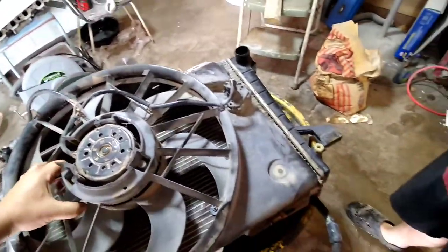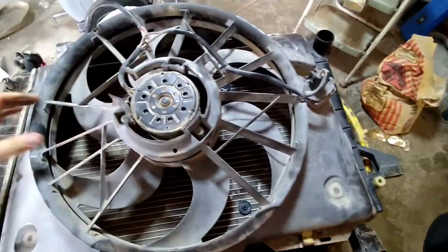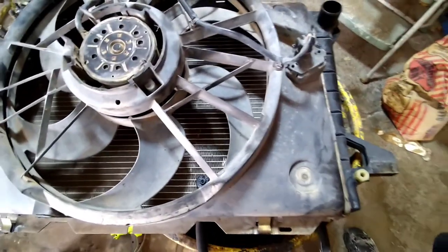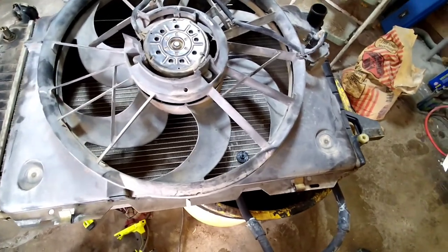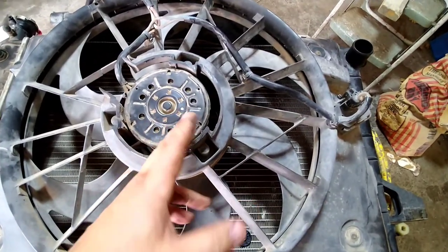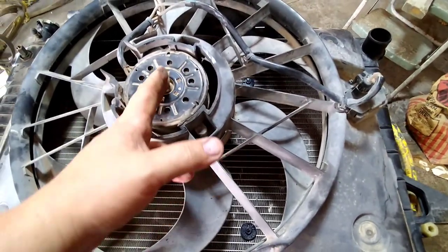This thing fits pretty much to a tee. I'm going to offset it all the way to the passenger side because the engine sits in the truck a little offset — if you center it, the water pump gets off to one side. So I'm moving it all the way over so the water pump sits pretty much centered.